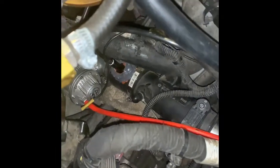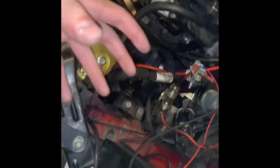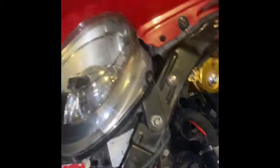I have seen people drill into here and thread it. If you do have a stock intercooler, you can thread it through the pipes because the piping is a lot thicker than my aftermarket intercooler piping. This is really thin — I don't think I can do a successful tap and I don't want a potential boost leak.